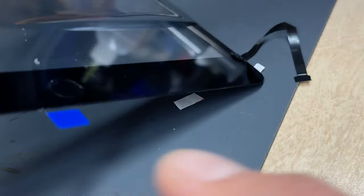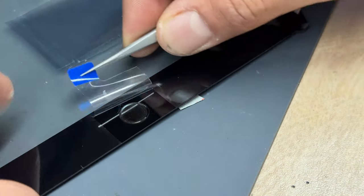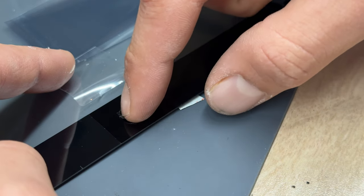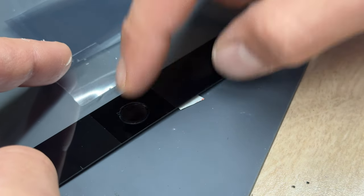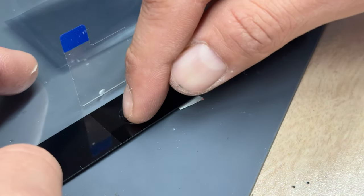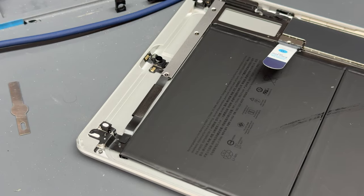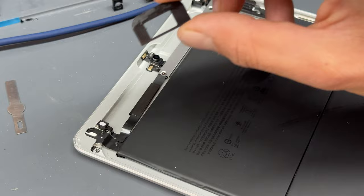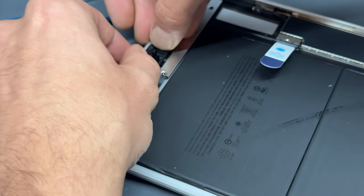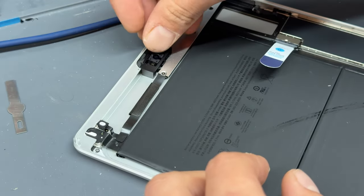Lift up the little bit of cable that sits there and sit the bracket underneath it — these have got some handy little guides showing where you need to place it, then push it down to secure it. For extra security, I use some UV curing glue and apply a small bead around the edges of the bracket, just like the original, and then set it for a couple of minutes with the UV lamp. Once that's cured, flip the screen over, peel back any plastic on there, and give the button a good bashing to make sure it's not going to pop off. Kids use iPads and they always press the button hard, so make sure it works well.